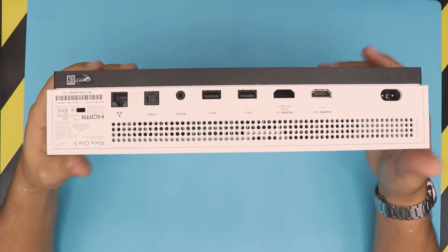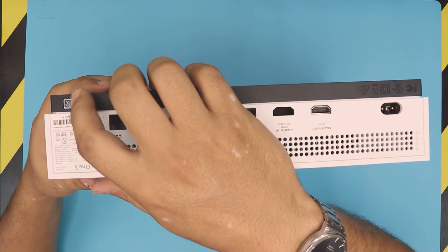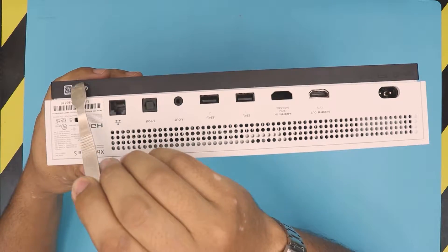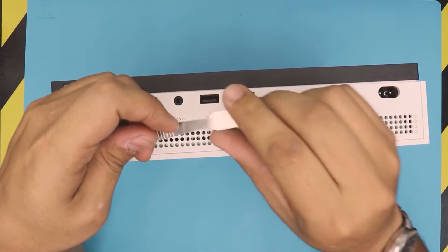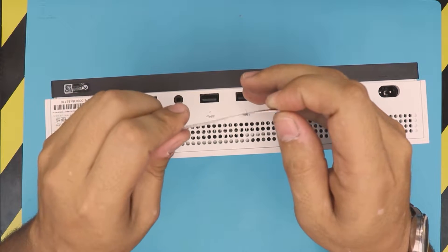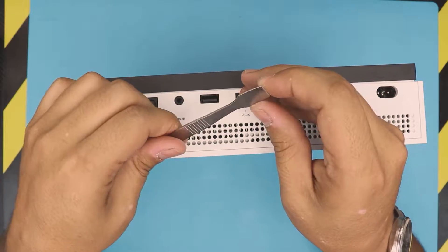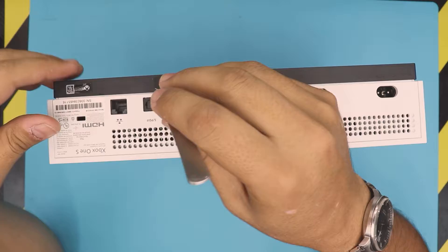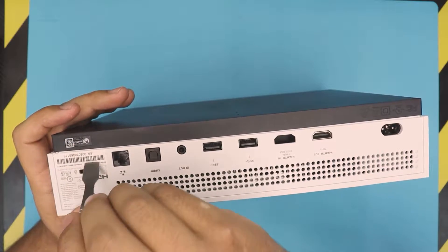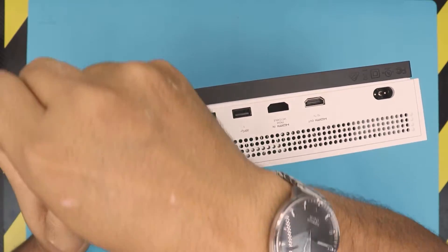First thing: check the back side — there's a warranty label right in the corner. You can peel it off or leave it on. You'll need an opening tool — something like a flat head screwdriver, something hard and a little bit pointy but not too pointy. Using this, you're going to remove the bottom tray. Start right where the warranty label is, stick the tool in there, lift it up, and move it forward to the side a little bit.